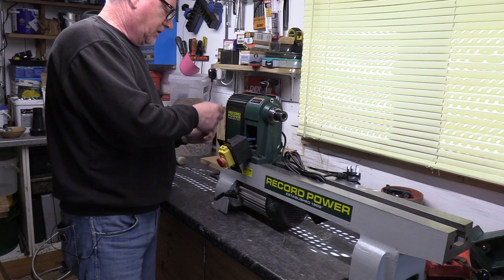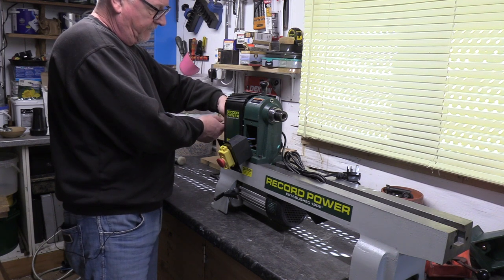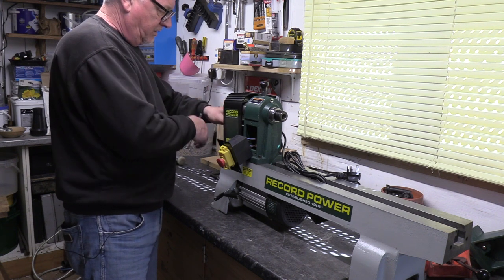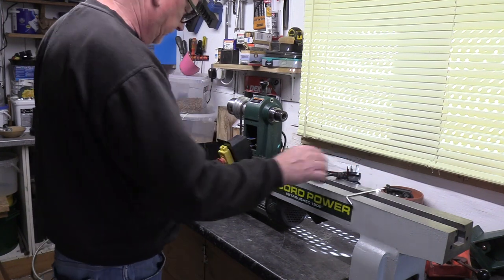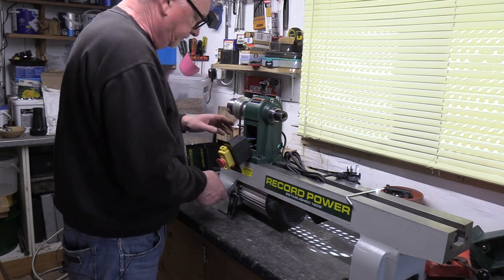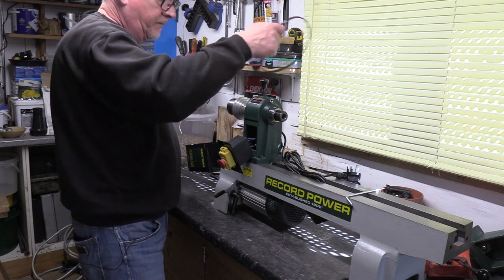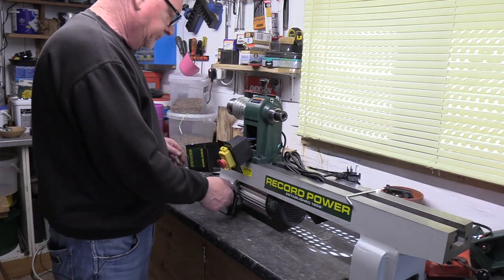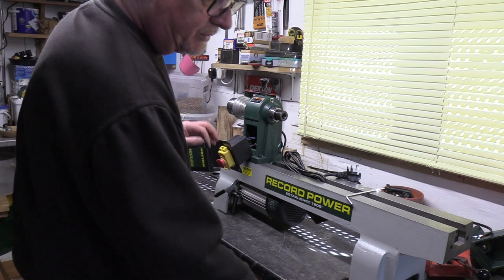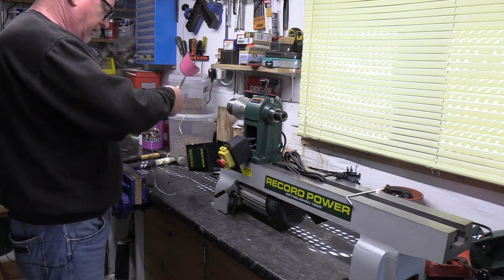I'll drop the cover down at the back here, and what I should do afterwards is take this cover off completely out of the way — it gives me better access and is less likely to get broken or be in the way. So the next step is to take your drive belt off. Pop that out of the way to one side. This switch is going to get in the way hanging about, so if you've got a rubber band or a bit of string that should help keep it out of the way.